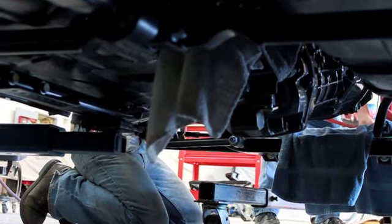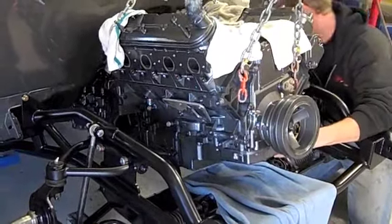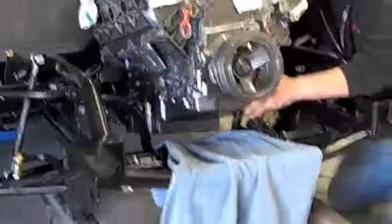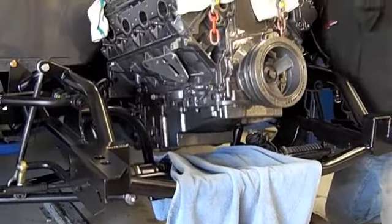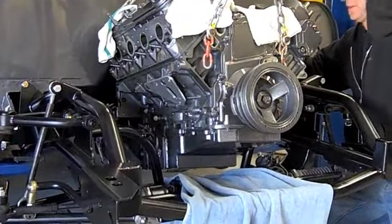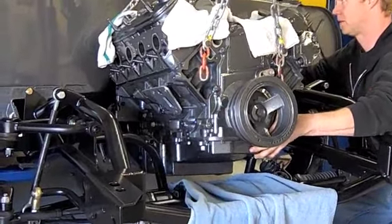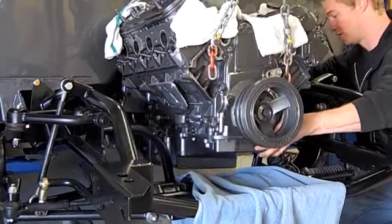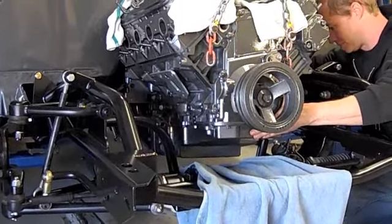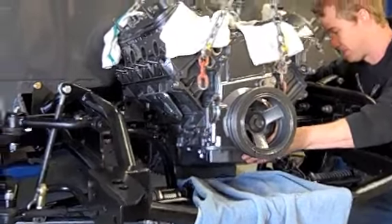The only thing we've had to do at this point is modify the oil pan just a hair. We've got a big sump oil pan on it from GM and we cut a little section out of the front of it. This front subframe comes with a motor mount set up for an LS1 — everything's ready to go and ready to fit. We've had the engine in three times at this point, and this is the last time it's going in for good. We set it in the chassis and then put the motor mounts in afterwards.